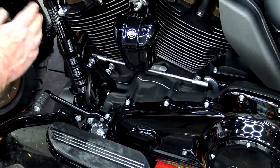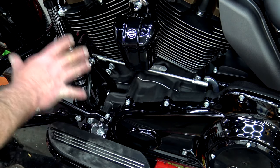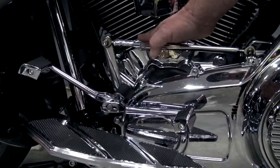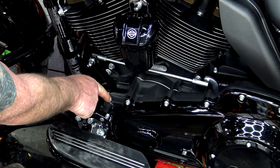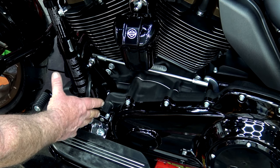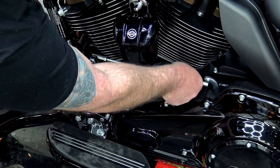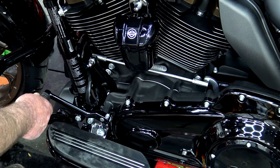On the pre-2016 — so 2015, 14, 13, 12, 11 down in that range — the shifter lever over here has a tendency to literally fall off the bike. The rear arm and the spindle itself can become loose, and this literally just falls off and flies off down the road. I'll put a link in the description on that video. When you get to your levers, grab this and make sure it doesn't have a bunch of wobble. If you do have any excess wobble, you need to get to Harley or order online a new spindle and a new rear shifter arm. There are bushings inside this that you can change as well, but usually it's not the bushings — the spindle is generally the problem. Check your rear one as well; if it's super sloppy, get that fixed.